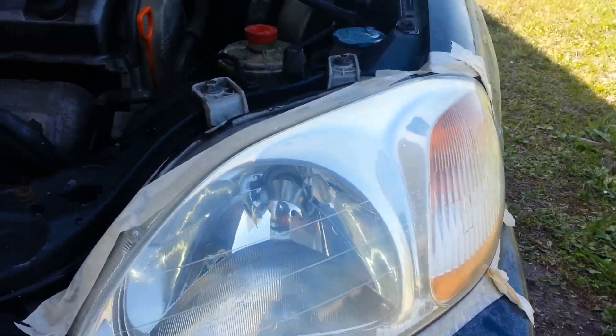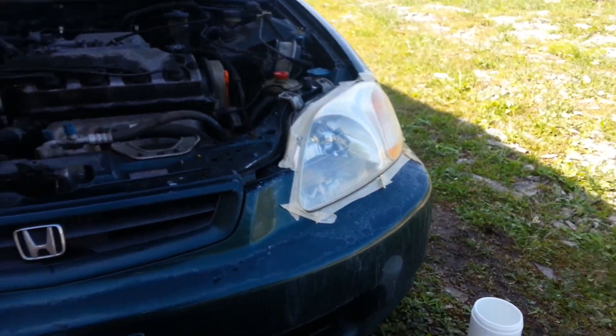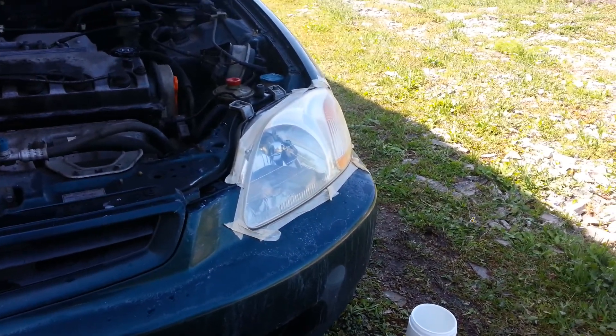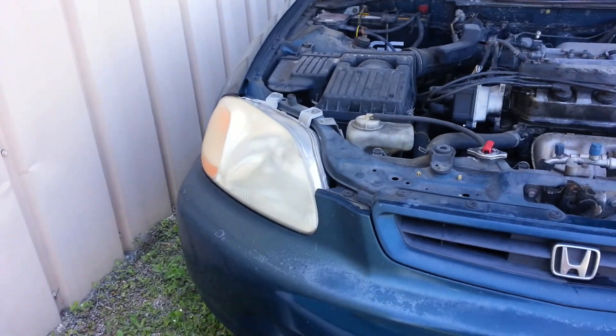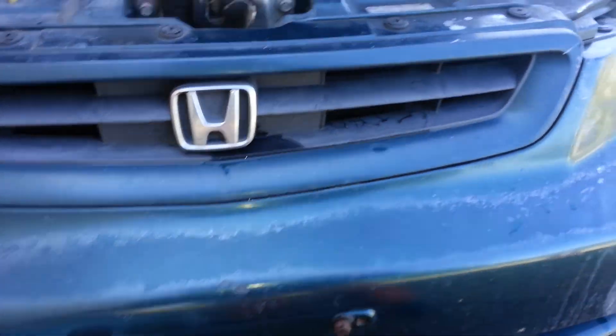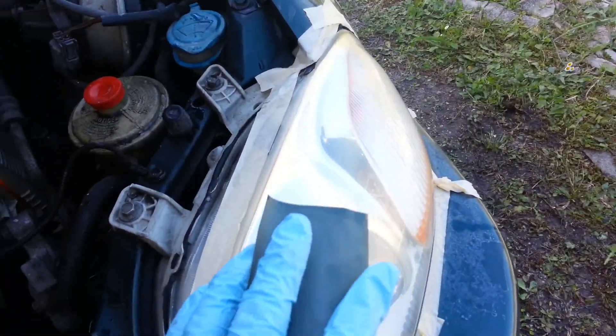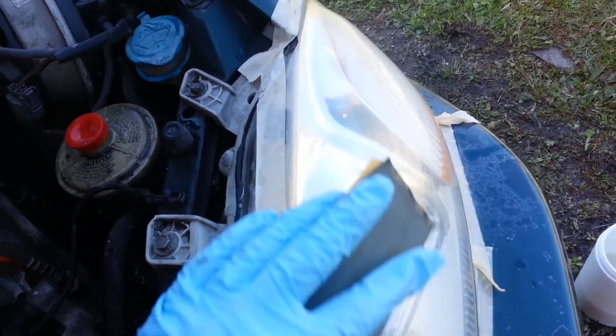Anyway, this light has a couple of chips on it but it looks so much better. It took me about an hour or so, probably a little longer. So with 1500 grit you do those motions like I said, and then you take the hose and hold the water over it, rub it all off, and clean everything — clean your sandpaper too.